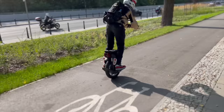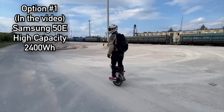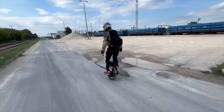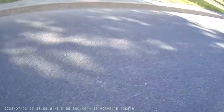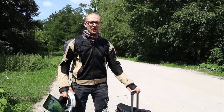You can help yourself with an app that will tilt the footplates back at certain speeds or certain amps on the controller, but I wish it were built in, like on King Song or Inmotion wheels. It's great that the Begode Master comes with different battery options — if you're a high-performance rider, definitely go for the Samsung or Molicel cells, as they have smaller internal resistance and deliver more performance with more headroom. All of these things led to a couple of cutoffs on the Begode Master, and a couple of near-cutoffs where the pedals dipped — also due to faulty soldering on the battery packs. The calmer you ride, the safer you will be.